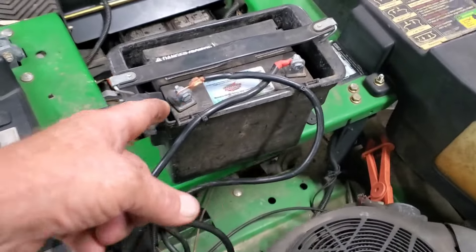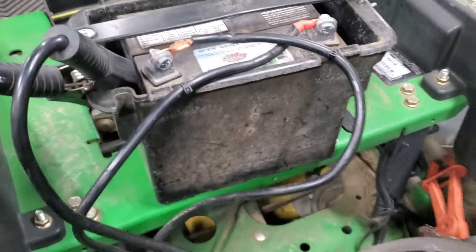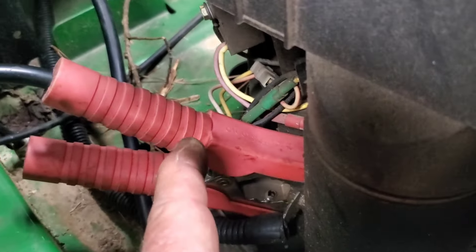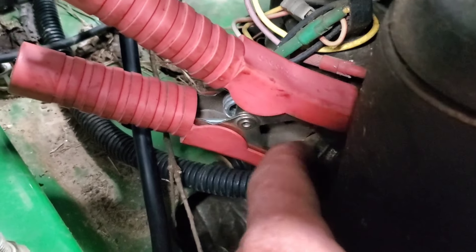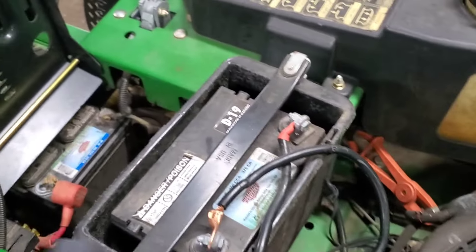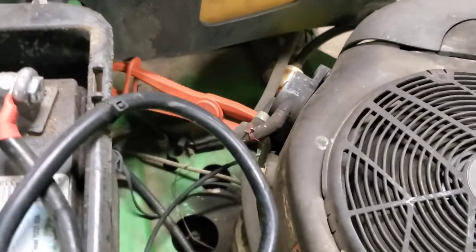My fancy jumper box is just an old lawn mower battery with some clamps on it. I'll take my positive and hook it right down here on the starter terminal, making sure nothing on my clamp is touching. I hook this on because if you just touch the positive you'll be sparking, and I don't like putting arc marks on the threads and bolts. So pull your spark plug out, take your ground, touch it to ground, and we're going to test our starter. It spins over — you can hear that.